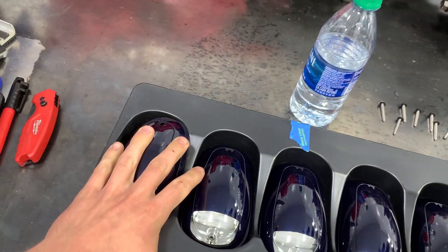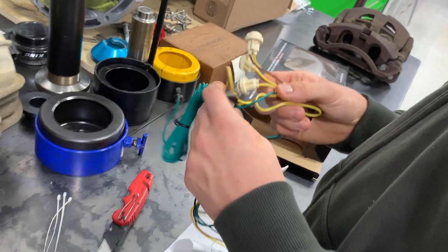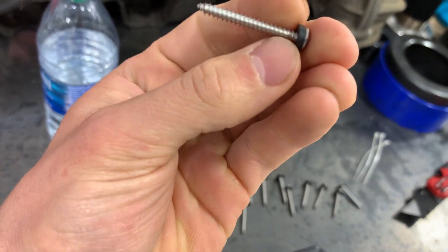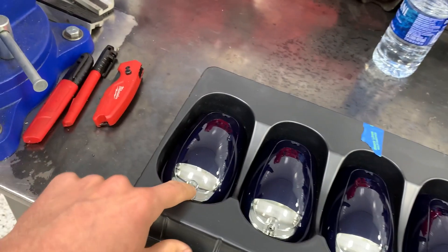Since this truck didn't have cab lights, we got the wiring harness for it, which is this little mess. It basically runs everything — your positive wire gets power with the headlights. These are the little screws with little grommets on them, and we'll use silicone to make sure none of this leaks. In reality it's not just one, two, three, four, five holes — it's three holes per light. Yes, everyone thinks cab lights means the whole truck's gonna leak and the headliner's gonna be destroyed, and there's a chance they could leak, but we take so many precautions: on top of the seals they give us, on top of siliconing every single hole. After you see how it's done you definitely feel a lot more confident. Without further ado, let's get to work.